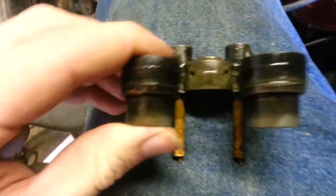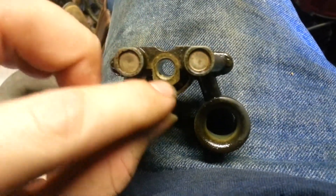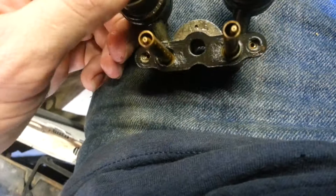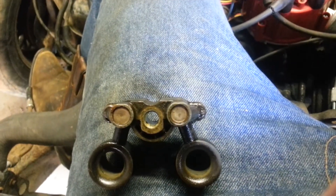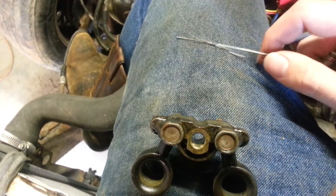Sorry if it's kind of crappy — I'm trying to do this one-handed. I was having problems with fuel coming through these little holes right here. There are a lot of little holes on these — there are holes everywhere you've got to clean out. I'll show you — you've got to clean these through the back too if you're going to do this. I'm using tip cleaners for a torch, just basic little tip cleaners.